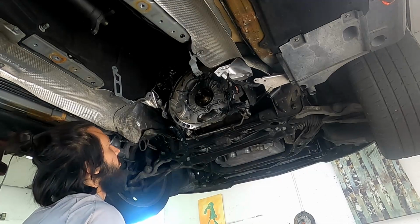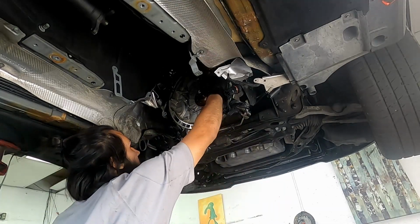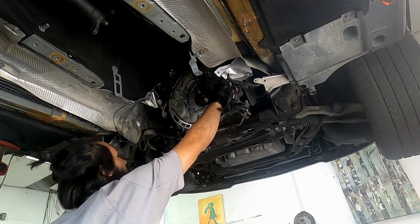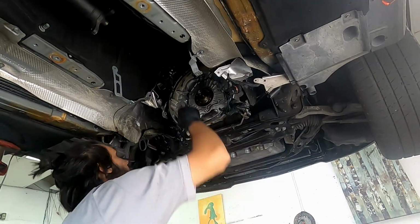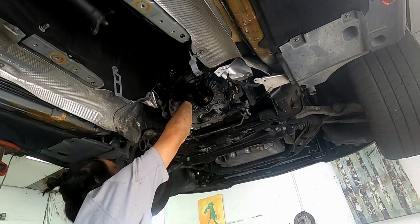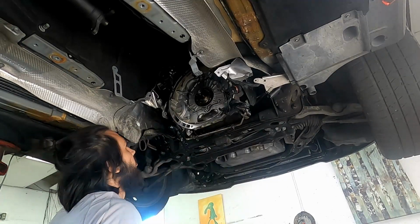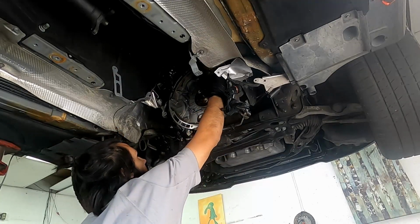the manual did not give me any torque specs for this rear housing. Given it's an M8 or M7 bolt, as most of the other small ones are, I can see about 100 inch pounds is really the max they can take.